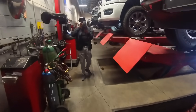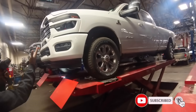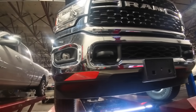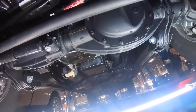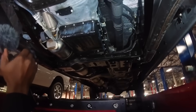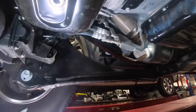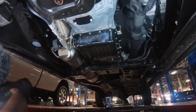We've got JB from JB Reviews and your master tech from Truck Stuff. We have side by side a 2025 with the new PowerLine transmission and a 2024 with the old standby — that's the Aisin. There's the trans pan to prove it's an Aisin. The pan looks totally different too, no cooling elements on it, but this one also has that thermal bypass valve, which is prone to failure. When we get over to the other truck you'll notice there is no more thermal bypass valve — they don't need one with the PowerLine transmission.